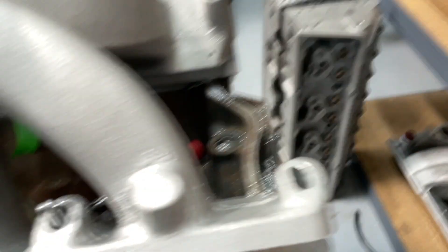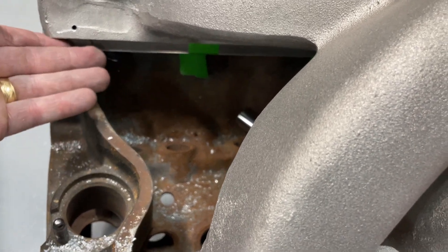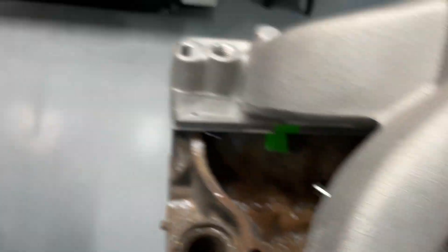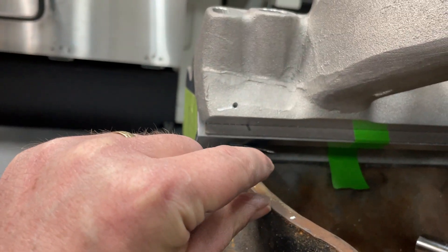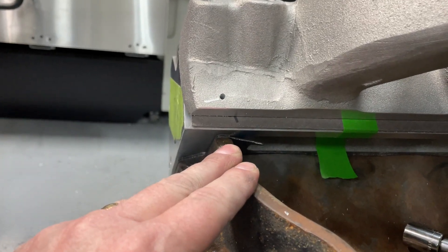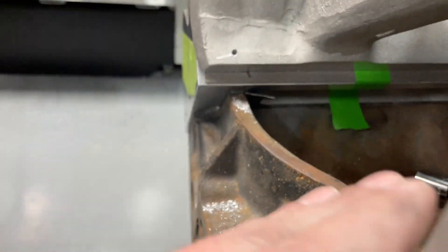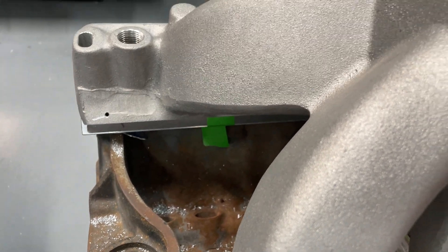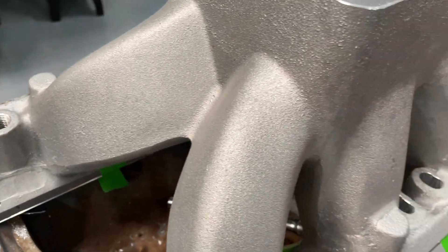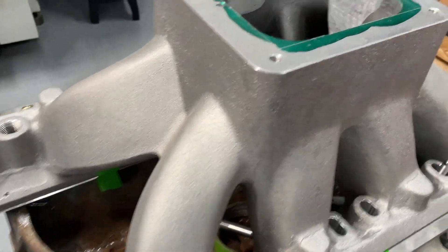The other problem comes from this — now this is for Ford and Chevy. This intake does not have end rails; it's got a spacer plate or valley tray that goes underneath, so you don't have that problem. But with the other Ford intake, if you cut the flange down, it drops down and lowers the gap. This only becomes an issue if it hits — the smaller it is, the less silicone you have there, and it should seal better. However, if it hits here before hitting on the head, then it's not going to seal. Hopefully that gives you some information and helps you with port alignment. The point I'm trying to make is if you're trying to get a perfect port match, it's better to mill the manifold first to get it down and then port. Usually it helps out a bunch.